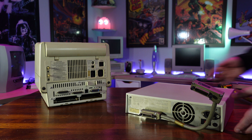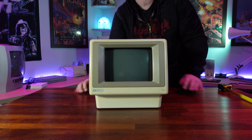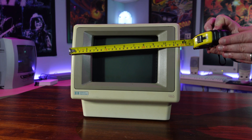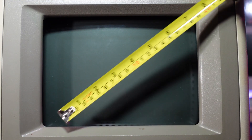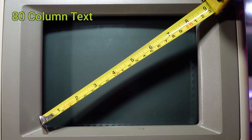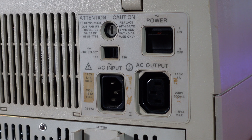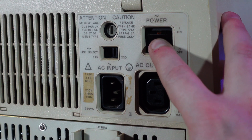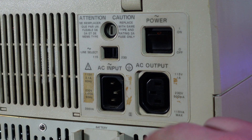With the storage unit concisely explained, let's refocus on the actual computer. The overall dimensions are pretty small at roughly 12 inches cubed, though it looks larger due to the relatively small cathode tube. That's a 9-inch display provided by Sony, capable of 80-column text mode as well as bitmap graphics at 512 by 390 pixels. Round the back you've got the power supply section at the top right, with the on/off switch easily accessible by just reaching around the monitor. Below that you've got the standard AC input, as well as an AC output for driving the disk module.